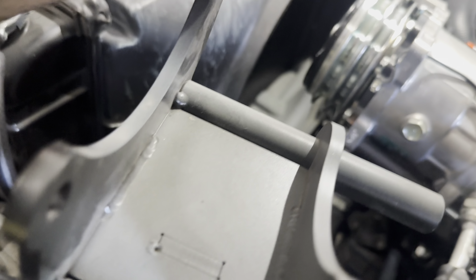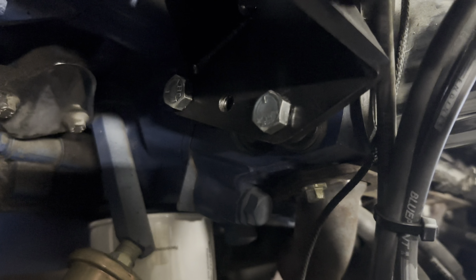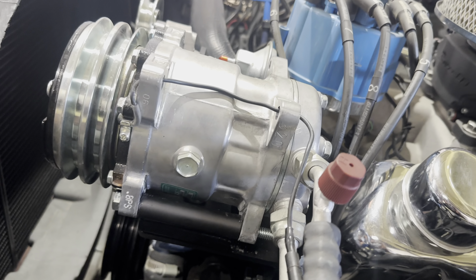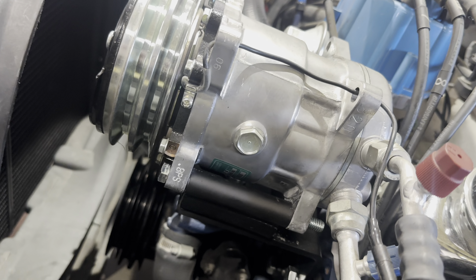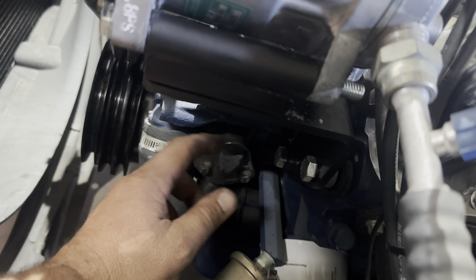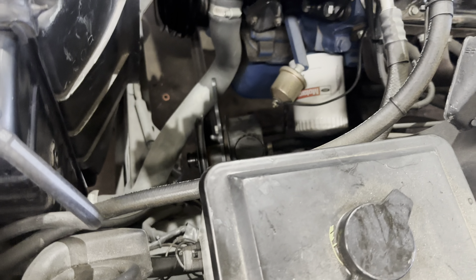Which that locates into those bolts on the head. So I think in order to use that power steering bracket, we might actually need to stud, because these two holes are these two bolts. You see what I'm getting at? There's two here — it's gonna be the upper one, probably different lengths. So that's where that bracket was. If we stud this, we could probably do that. Let's re-clock that first and then just eyeball it and see what we got.